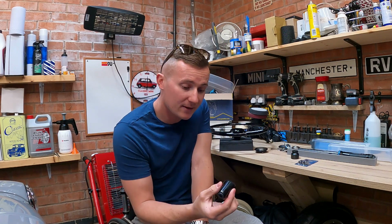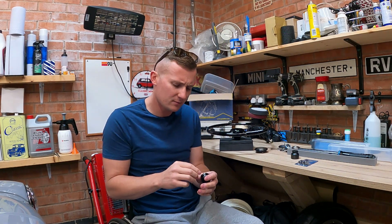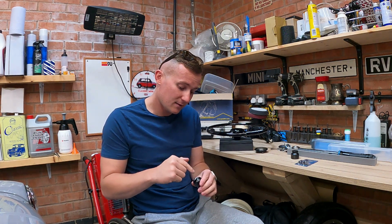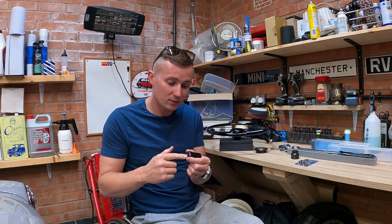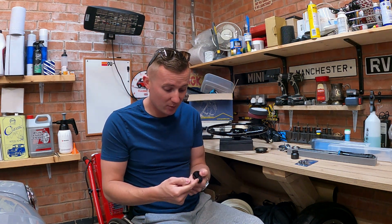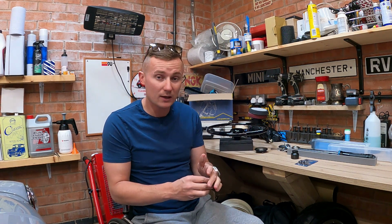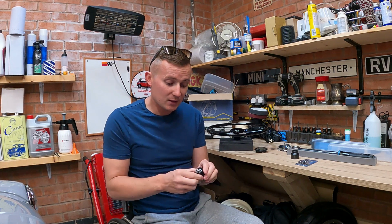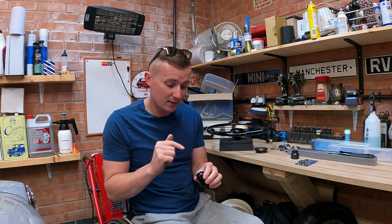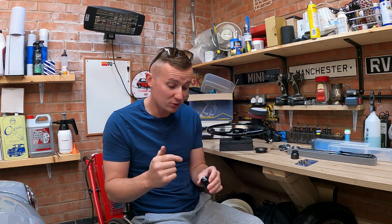Like I say, I've just got a standard replica gear knob as well. So you may or may not have seen the Mark I being adapted yet. So when they adapt the cars, they have to drill through the gear knob for the sensor to come through. So the sensor basically comes up through the bottom of the gear knob and then out the top there. So obviously when I put my hand on it, it knows that I want the clutch to dip. So I've actually bought another one of these for the Mark I, which I'm going to drop off to Liverpool when I go next week, because the Mark I's actually got an original gear knob in it, and I just think it'd be crazy to drill an original one.